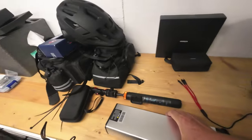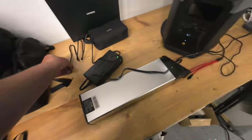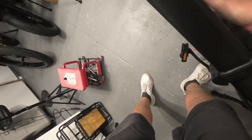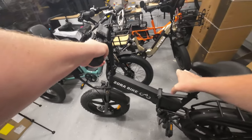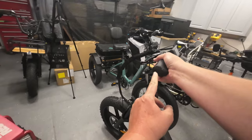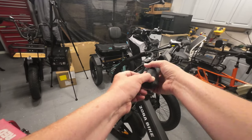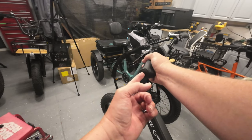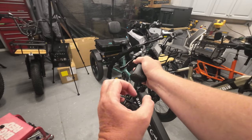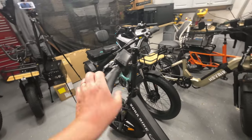The frame is a mid-step — not a high step, not a step-through. Some bikes come in without caps on the handlebar ends that allow you to insert bar-end mirrors. The handlebar is still hollow under the grip, so all you have to do is take a razor blade and cut an X through the leather grip. When you install the mirror, the end of the mirror covers up the cut so you can't see it and it doesn't fray. That's what I'll do on this one when I get ready to add the mirrors.